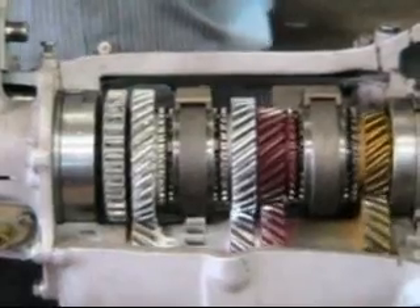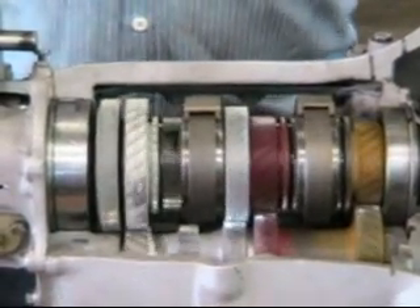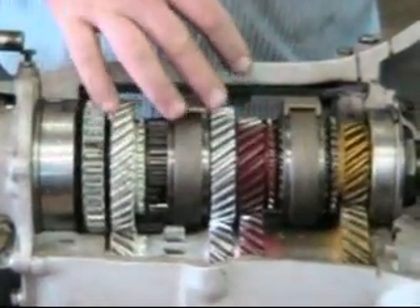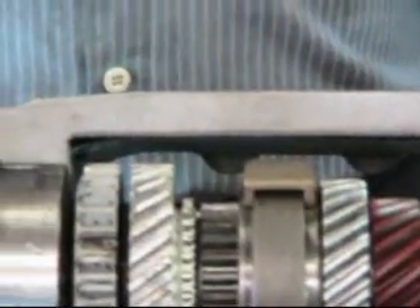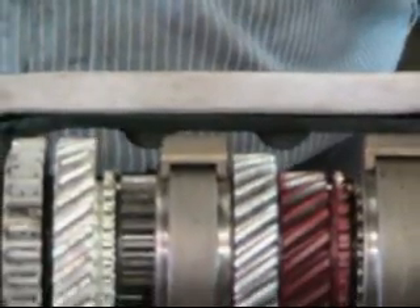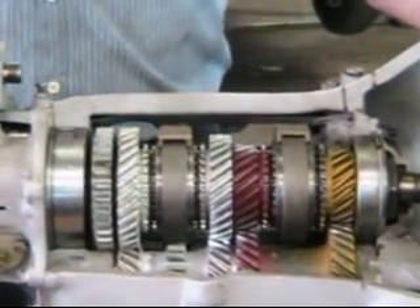While this is running it has to be oiled. So we're running along here — let's put it in second. This is all filled with oil, and the oil is getting washed up over the top. There's a trough that runs along the inside that drools back to an oil pump. That oil pump has a scroll thread — it screws the oil forward, pushes it into the main shaft, and it exits underneath each one of these speed gears and up inside. That's what keeps the gearbox nice and oiled.